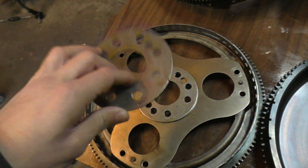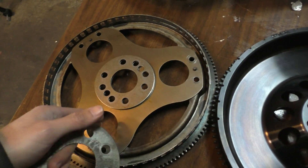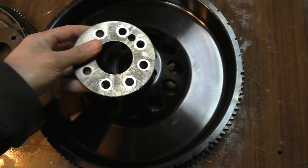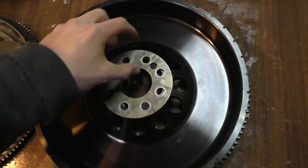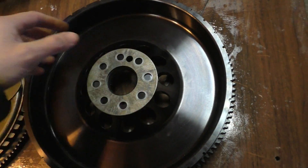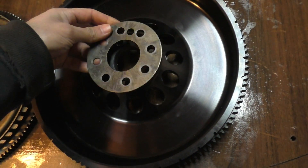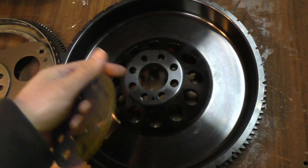They are both M113K engines — this one was from 2004 and this one is from 2006 — but they actually have two completely different bolt patterns. This is really bad for me because if it had this bolt pattern it could have worked pretty easily, since this bolt pattern is actually pretty similar to the bolt pattern of this flywheel. It has eight bolts all 45 degrees apart, so I could have offset by 22.5 degrees, made one adapter, and bolted everything through offset holes.